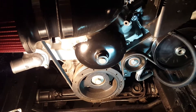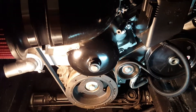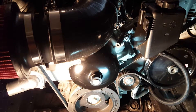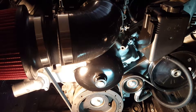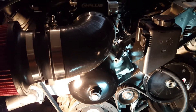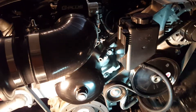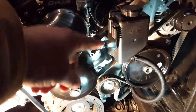There are a few things you need to know. First of all, this type of pump — the LS style pump in this application — is called a Type 2 pump, not a Saginaw. GM small block Chevys usually have the older style Saginaw that has a reservoir right on the pump itself. In this case, this is a Type 2 in a later model with what they call a remote reservoir, meaning it's located in a different location away from the pump.